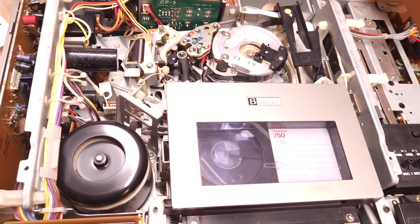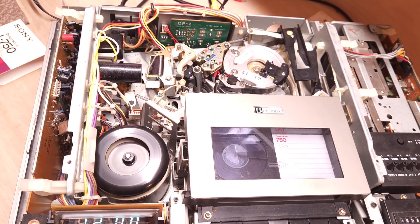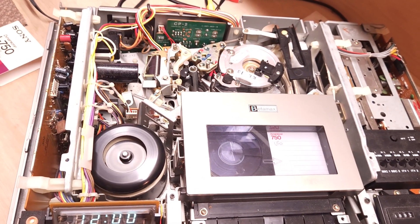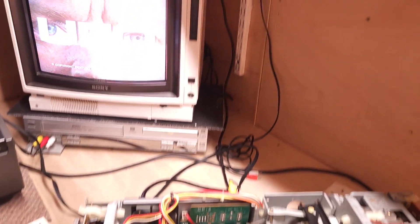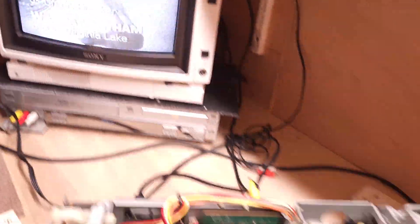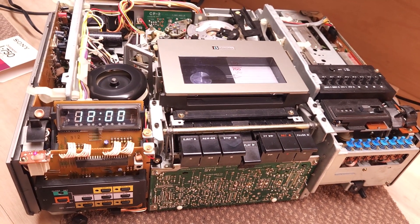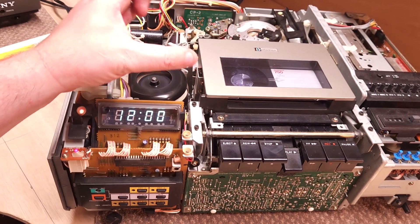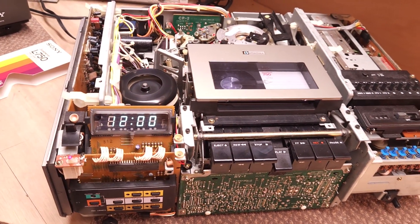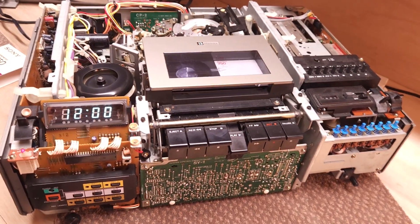I'll keep on going with this — I've had this thing for 10 years, so it's really just me trying to tweak and change it. You can see on the word 'center' there — it's just wobbly. That was just a quick attempt at double-checking the eccentricity of the video drum, whether it's actually centered on the spindle itself. It seems to be okay and within specifications, so let's look elsewhere. Thanks for watching — see you on the next video.